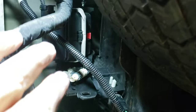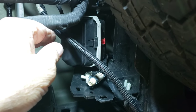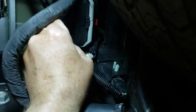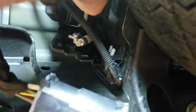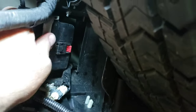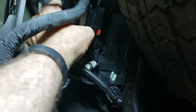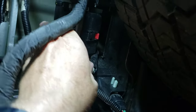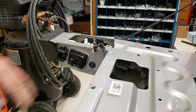One thing to keep in mind: you've got to take this tailgate down and release it because once you unplug this you're not activating that button. So you peel this thing back, push the little knob down right here, peel this back, and then push down right there and it'll come apart. Just slide this red thing forward and then push down on the tab right behind it — it'll come right off. Now I'm going to take all this right here off.